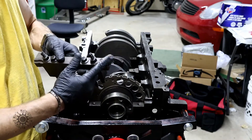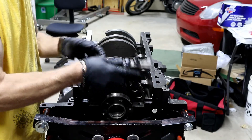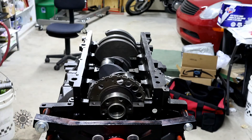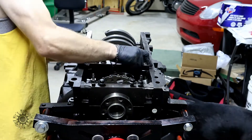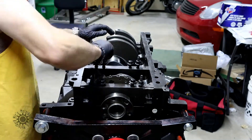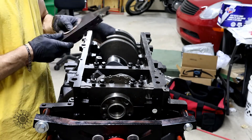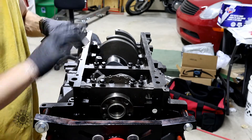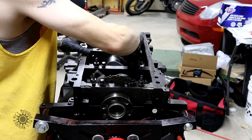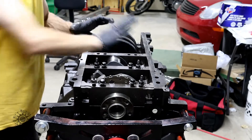Make sure your caps go the right way on the GM 5.3s — your tabs point forward. I always like to have a lot of extra assembly lube; never hurts. On your GM 5.3s, your center crank bearing is also a thrust washer — that's why it's designed that way. So just make sure you remember that when you're assembling these. That is your center line, and it does have that thrust washer, so make sure that gets done.